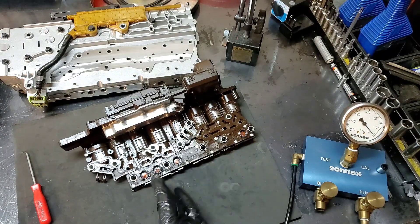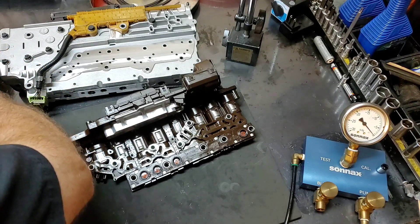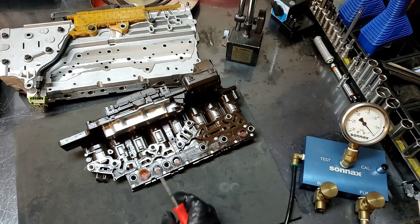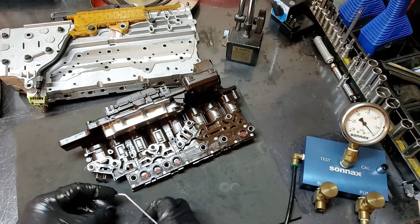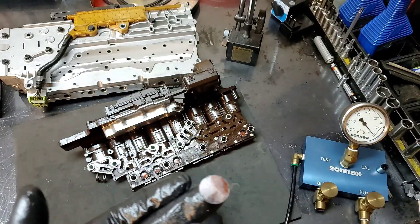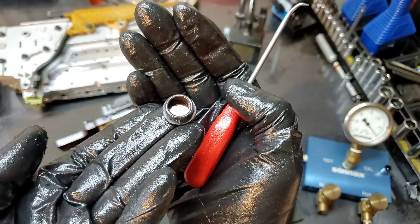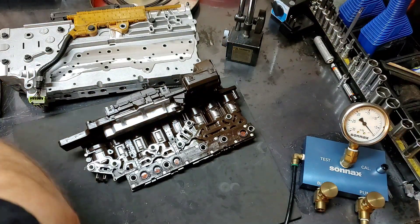Perfect seal, perfect seal, perfect seal, and perfect seal on all of them. As you can see, when you install these things you cannot see underneath — you don't know where that membrane is. The membrane has to be underneath the small port and underneath the seal. When installed, on the bottom side it'll look like it's cupped on your finger, and on the top side it looks flat. It has to be on top of the switch for it to seal the way it should.